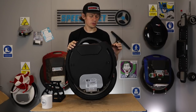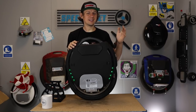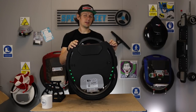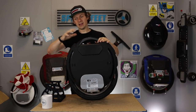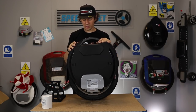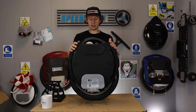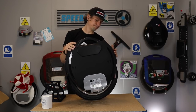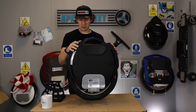That lock mode is for transportation. If the button gets pressed during transport and that isn't enabled, the wheel can boot up and as the package is turned around it can spin, eating all the packaging inside and wrecking your wheel — burning the motor or the board out. So don't be surprised when it does that.